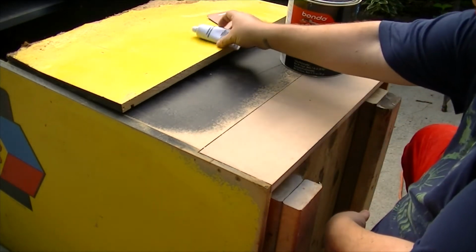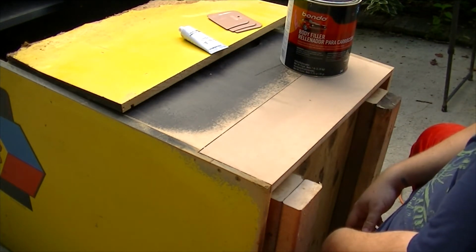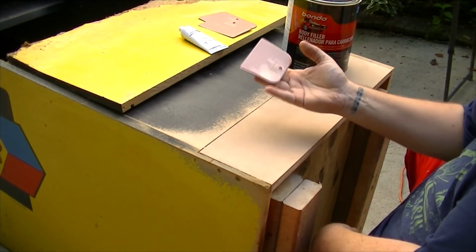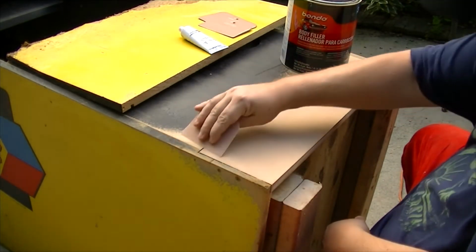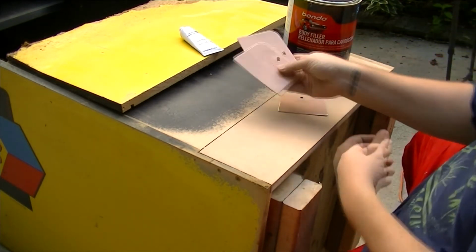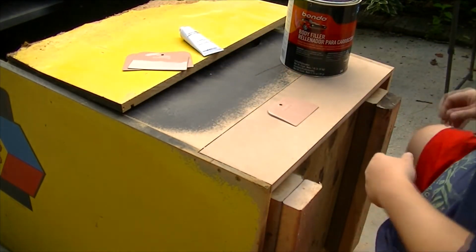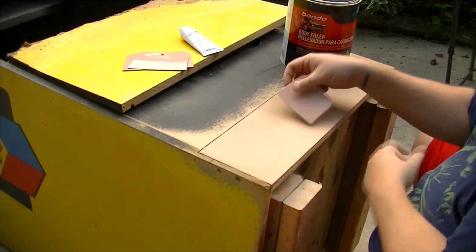And then it comes with two-part liquid hardener. You guys can Google Bondo how to set it up. I'll just show you what I do with it. And I got these Bondo scrapers. You can get these for like $2. AutoZone or Pep Boys or any of those type places will have these. And they just make a nice smooth edge. You got three different sizes to work from. This is the one I use most of the time. And when I do a big seam, then I'll go up to the middle one. And the cool thing with these is when the Bondo dries, you can just bend it and it comes right off, and then you got it all brand new again.